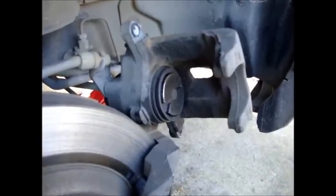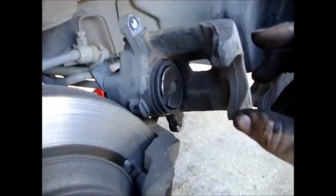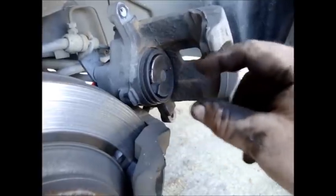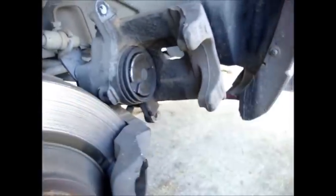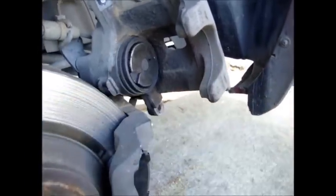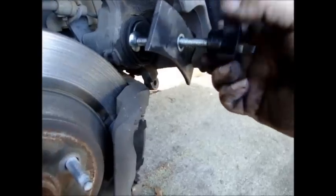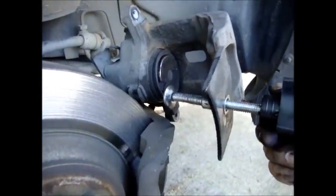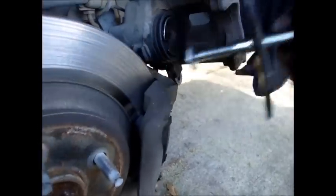I learned two things from this experience. First, you have to make sure the gasket or boot is actually folding down the way it's supposed to be. I made the mistake of not watching, and when I finally got it down it was all bunched up, so I had to take it out and push it in all over again. Also, when using your compressor, be gentle going down — if you tighten it too tight it binds up the caliper so you can't turn it. Just go down until you feel it tighten up, so you can still use your vice grips or channel locks.